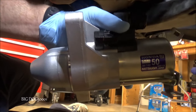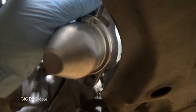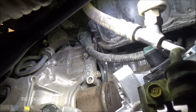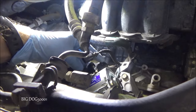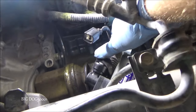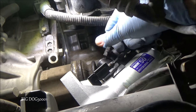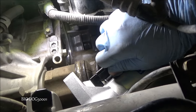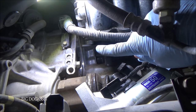We're going to put the starter in the same way we took it out. We need to make sure we have it angled right — that's how it goes in the car — so we need to fish it up in here like this, kind of get it into place, and then connect the S-terminal and battery terminal. I put the terminal on and now I just need to put the nut on top. I got the nut started and tacked down — it's only about 7.2 foot-pounds. I got the rubber boot back over the top and the S-terminal snapped back in. Give it a tug — you don't want that to come out.